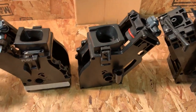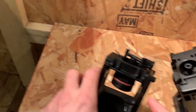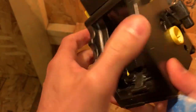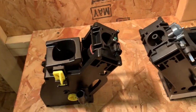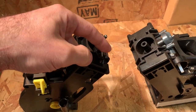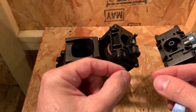All these brew units require degreasing. You can tune up the brew unit by replacing the seals, replacing the shower filter, and doing all the various greasing in the hinges and the spout. But one thing you're not able to do at home is clean the inside where the coffee is actually running through.